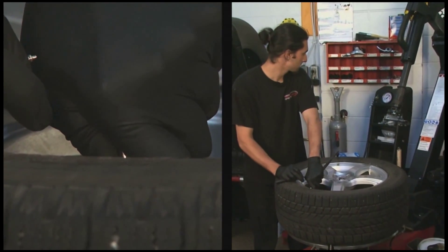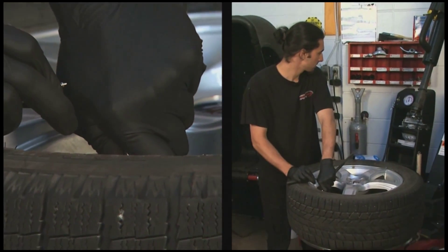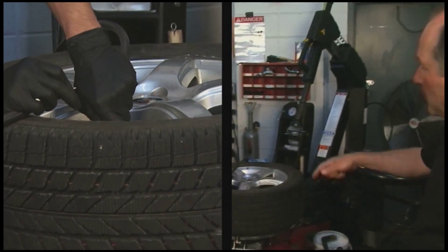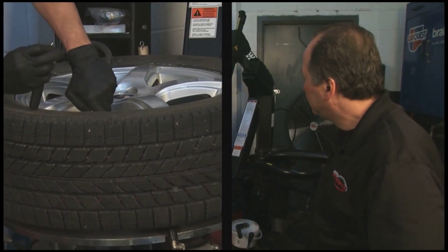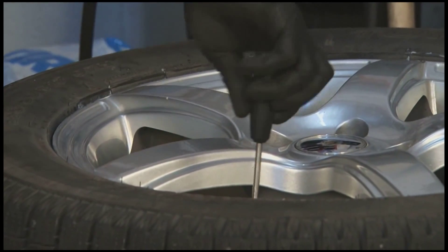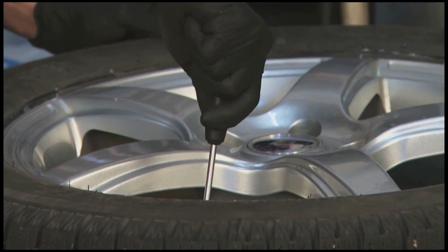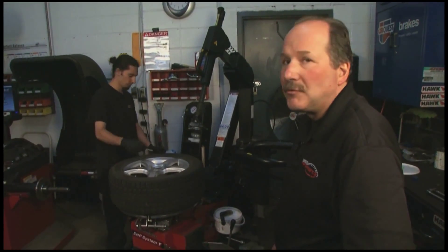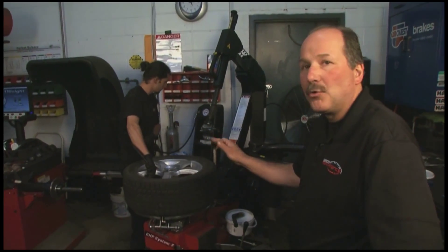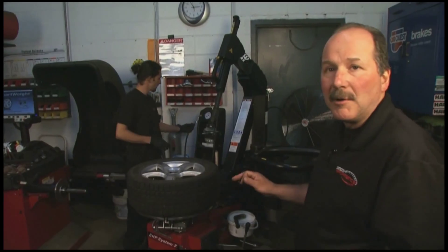The reason why you do this is because you want the tire to sit on the rim nice and square — that way you know it's going to be nice and true when it's spinning. You're going to hear this wrench ratchet. This way you cannot over-tighten that valve. The valve is now fixed to the proper torque specification, so we don't have to worry about it.